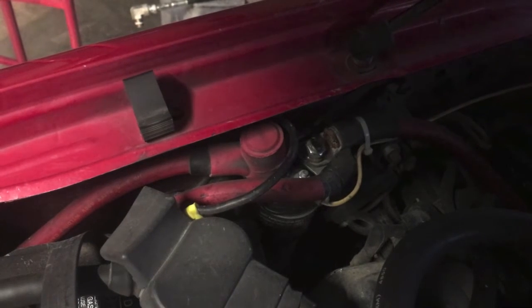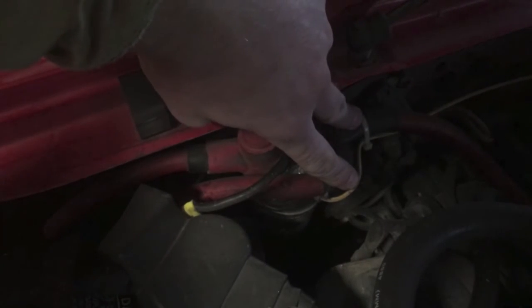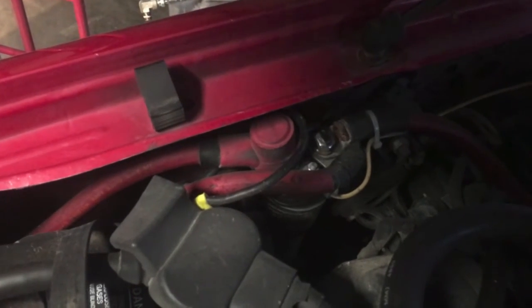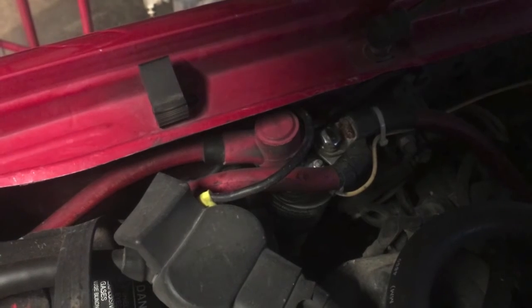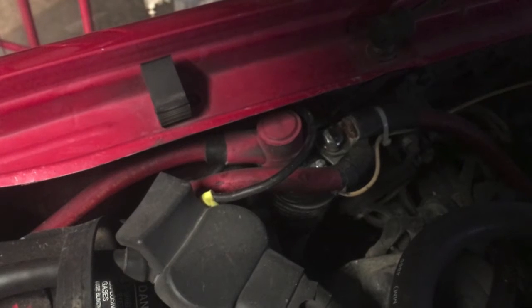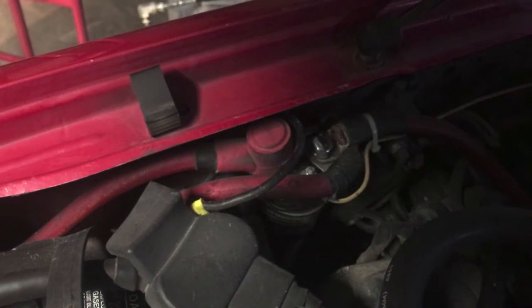Even though I'm using a big solenoid on mine, that was a concern I had, so when I made my cables up I made sure I left enough slack that if need be, either one of the cables that goes out to my quick-connect plugs is long enough to reach this always-hot plug right here. So if the solenoid goes out on me, I can bolt those cables directly on here and continue to use the winch. Be sure you're using an appropriately sized solenoid — I found this one on Amazon, it's rated for 500 amps, and I'll put a link in the description so you can check it out.